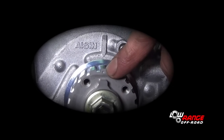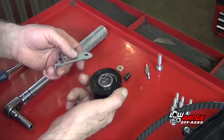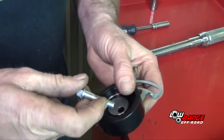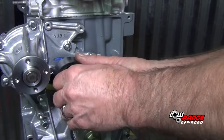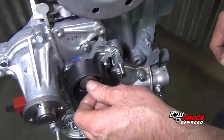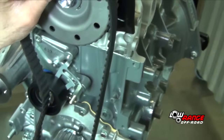In this position with the crankshaft timing mark up and your camshaft timing mark up, you'd be on top dead center number four. Now we're going to install our timing tensioner. We have our timing tensioner bracket and our timing tensioner. You want to locate the hole on there and line up the little tab in that hole — that's what's going to actually adjust the pulley itself. Then we're going to install it right on the engine, making sure that your timing mark stays lined up.